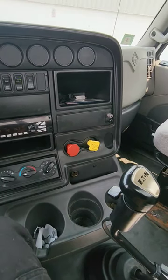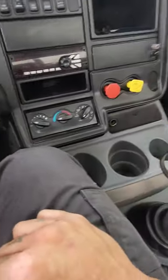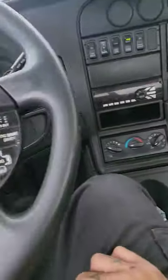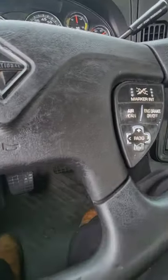That will release my brakes. So a good way to remember that, because it has to be in order: stick, first gear, key off, key on, valve, valve. Stick, key, key, valves. Okay, it's really important. A lot of people fail there. So just try not to mess up the order. Has to be in gear before you turn it off.